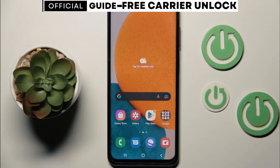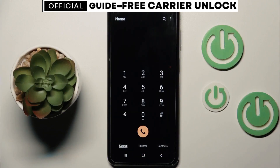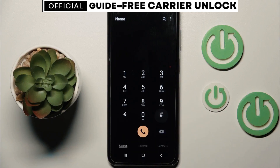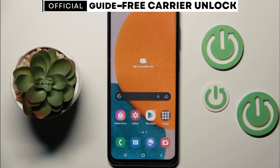We're going to start by getting the phone's IMEI number — that's a unique number for every phone. To get it, simply dial star hash zero six hash. Your 15-digit IMEI number will appear on the screen. This number is very important, it represents the ID of your phone, so keep it somewhere close because we're going to use it to unlock this phone.